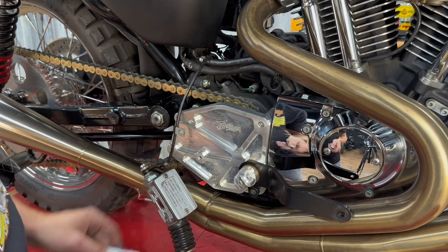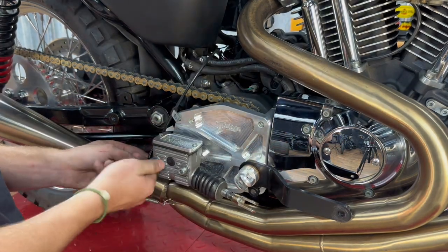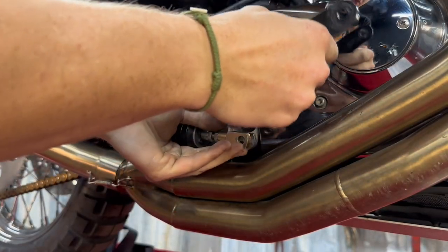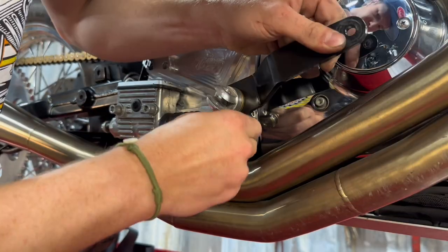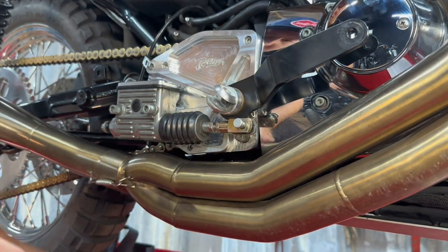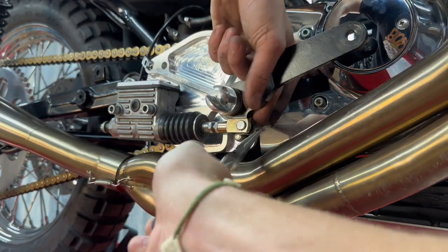There's also a three-quarter inch nut to tighten down located directly underneath your brake lever. Next we're going to install our rear master cylinder — that installs with two quick quarter-inch allen bolts. After that we can install our brake clevis to our brake lever. The brake clevis and brake lever should line up pretty well, but it might need a little extra encouragement to get that bolt to slide through. Once it's through, install a cotter key on the back side, bend the edges so it can't come loose, and you're good to go.